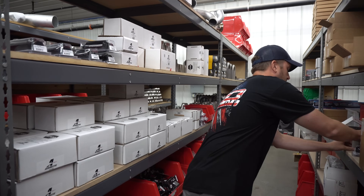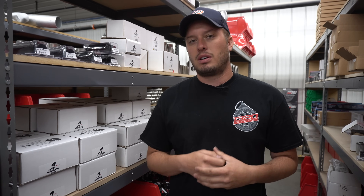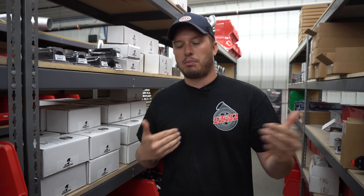Next week I'm gonna try to do a Tech Tip Tuesday where we cut different brand filters apart — not to bad-mouth anybody, but so you can see the differences. The takeaway from today is: if you're upgrading a pump, you need to look at filters, regulator, and line size too. If you had a number 8 line on that Magnafuel, you don't want to run a number 8 on the brushless pump. We get lots of calls from people saying it didn't flow like expected — and they bought just the pump, not the rest of the system. That's the whole reason for our fuel system planner: so we can match everything so it performs at peak performance. Just buying a big pump isn't enough.